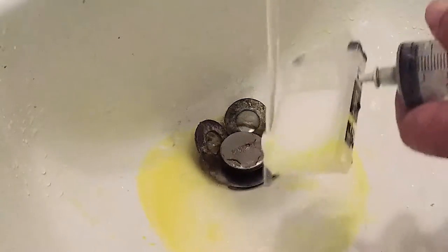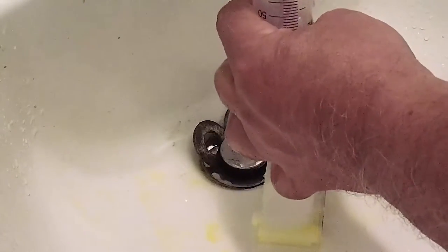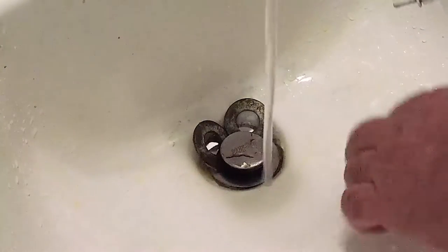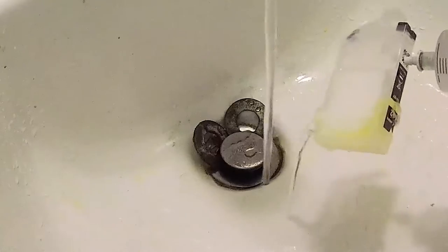You can see how it's coming off. You might have to do the pre-treatment with Windex twice, but once you do, you will be able to use that yellow cartridge. You will not have to replace it with a CLI-8 and swap the chip — and if you're not good at swapping chips, you might end up ruining the chip and its ability to attach to the cartridge body.